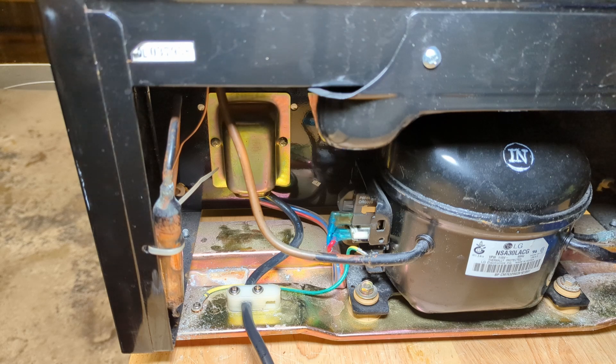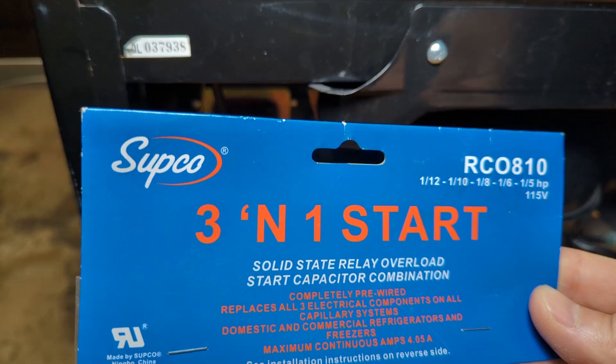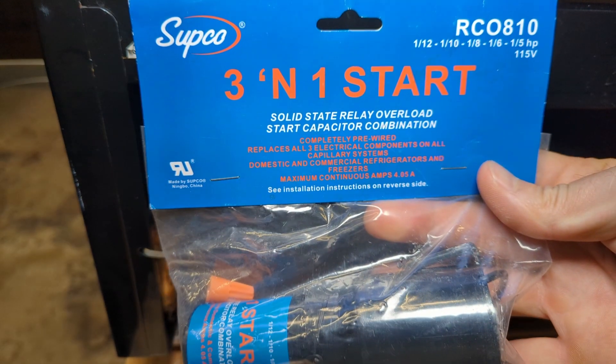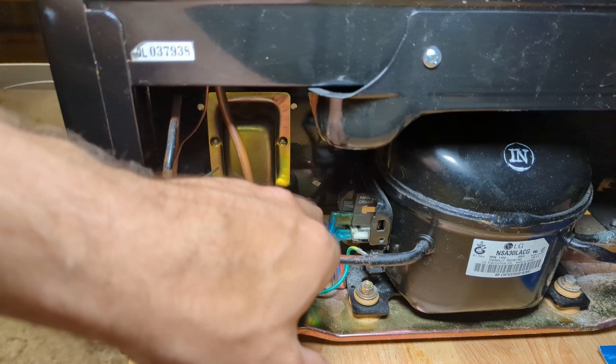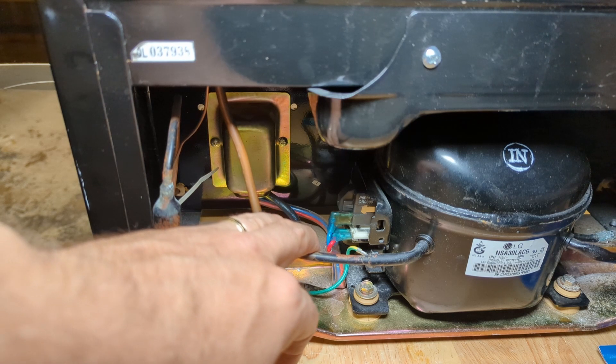So this thing was at the curb for really no good reason. It probably needed like an eight or nine dollar part. I'll look it up and leave a link in the description. Now, if you have this problem and you can't get that part, they make these universal kits too - this one's made by Supco. It's a lot bigger but it hooks up to the compressor terminal the same way. So if you can't find what you need or it's too expensive, this is a great alternative. I'll leave a link to this in the description too. So this line is the suction line starting to cool down and our liquid line on the other side is starting to get warm. So this thing seems like it's functioning.